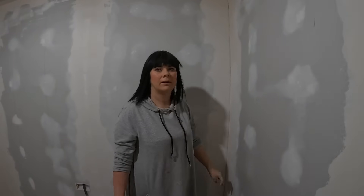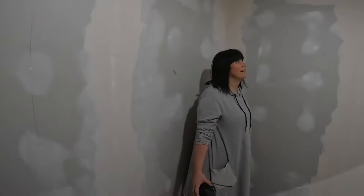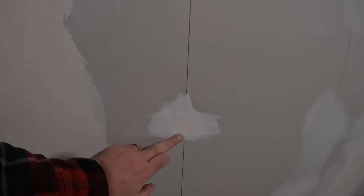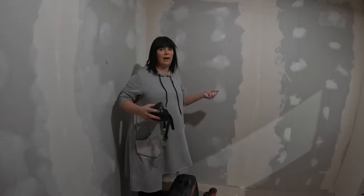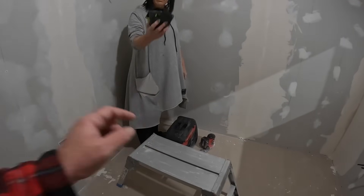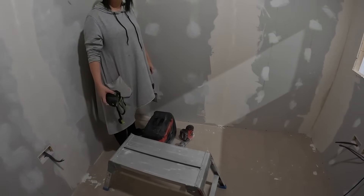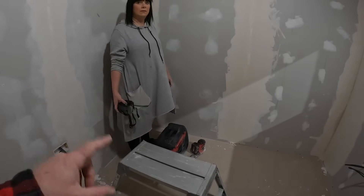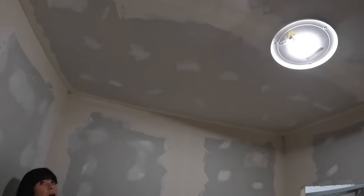She's showing me how smooth the sanding is — in the corners you'll have to do them by hand. I'll get her a block and some sandpaper to corner those in. She's worried she can't get the room finished today, but I reckon about a good hour, hour and a half of sanding and this room will be ready. When it's sanded it looks great. The issue is she's got the hoover in one hand — maybe try putting the hoover on the trestle and do all the lower half first so you're just using one hand. She needs an extractor with a longer hose because when she gets onto the ceiling she's going to struggle — standing on the trestle, one hand on the hoover, one hand on the sander, plus the Darth Vader mask.